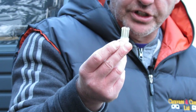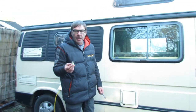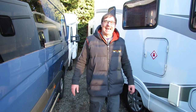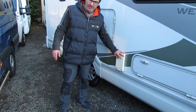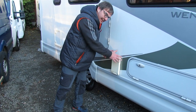That's your drain plug for your Carver water heater. You can put it back in without screwing it up tight, or store it safely inside your motorhome. If you need to know where your water heater is inside the van, the quickest way is to find wherever your flue is on the outside — the water heater will be located on the inside at that same point.